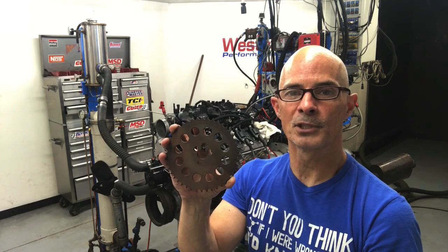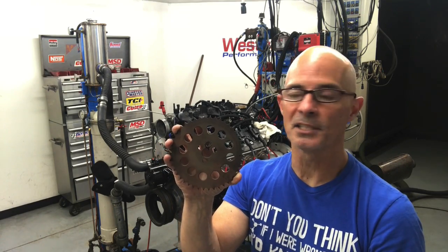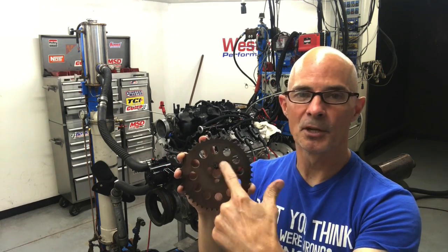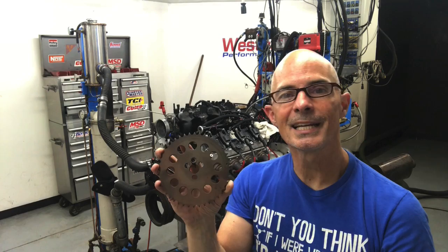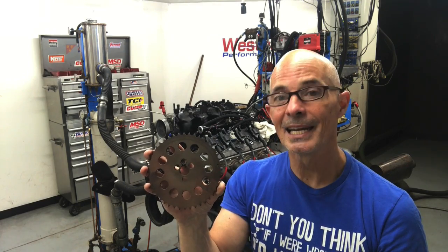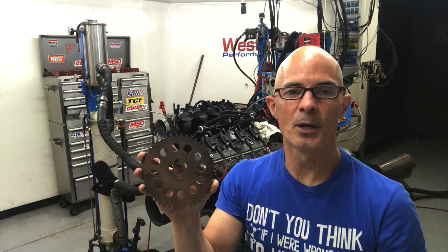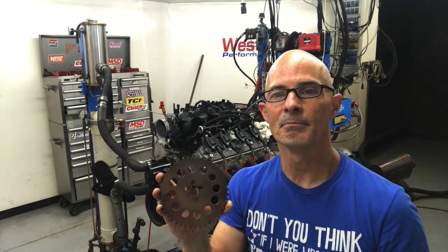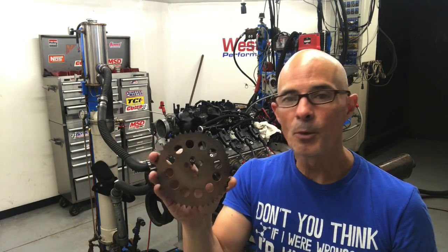If this motor spins in this direction and we tilt the cam in that direction, they happen a little sooner — that's called advancing the cam. The other way is retarding the cam. Now, everybody wants me to degree the cam and tell them exactly how many degrees it is. I'm not going to do that because I don't want to disassemble everything. Nobody would do that anyway — I never degree a cam when I do a cam swap. We just put it in dots to dots, the way that the average guy does it. That's what I do all this testing for.